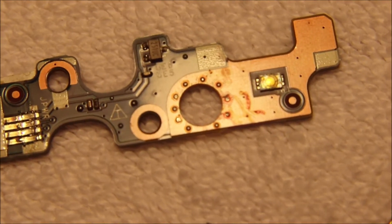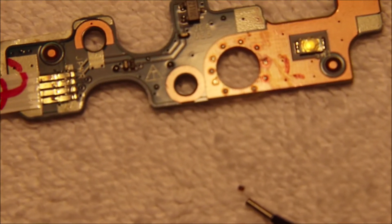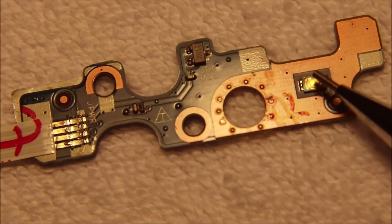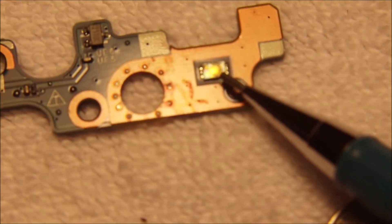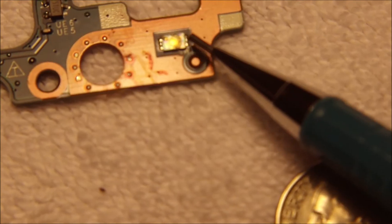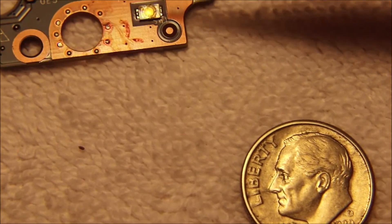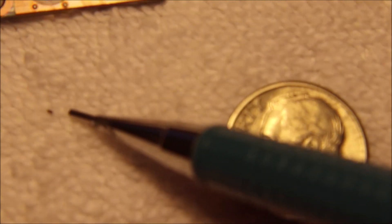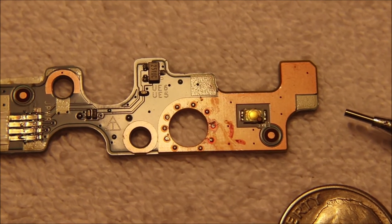Here's the problem. You see that little dot right there? That little piece is supposed to be attached to the very center of this button. I don't know if it's probably glued on there because it's a different material, but it's supposed to be on the center of that button. And that's why when you press the power button — the plastic power button — it's not able to push this all the way down. So you see how tiny that is? It's falling off. That's the reason it is not working.